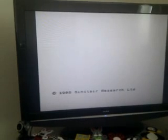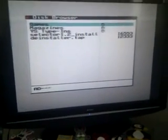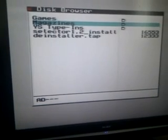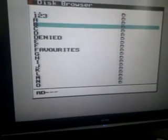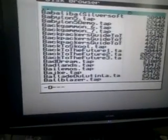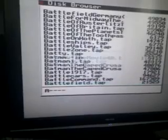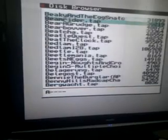On the Divide there's a little button — let's press that. A little green light came on as it was reading the Compact Flash card. There we go — FATWARE's disk browser has popped up. You just use the up and down arrows on the Spectrum keyboard. We want to go into Games. As mentioned previously, these were just copied onto a Compact Flash card formatted to FAT16 using a card reader on a PC, and they're all Spectrum emulator TAP files, which Divide supports.